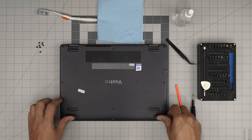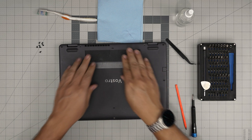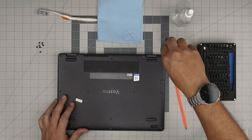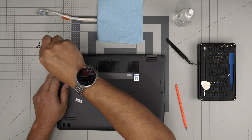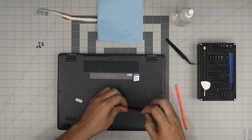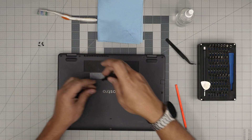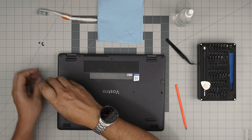Grab the bottom cover, put it on top, and push down the corners — front corners, sides, and mid-back. Don't push on the C-lock corners; instead, twist those screws and they'll pull the cover into place. After that, if you see any gap openings, just pinch them together and they'll close. And that's how you do your own service for the Dell Vostro 3000 series. If you have any questions or requests, leave them in the comments — thanks for watching and I'll see you in my next video.